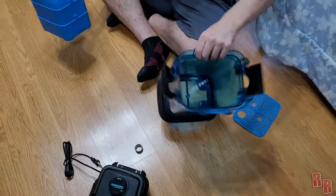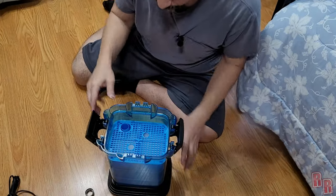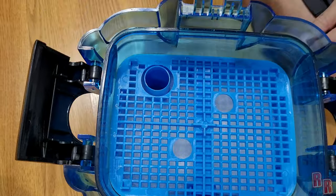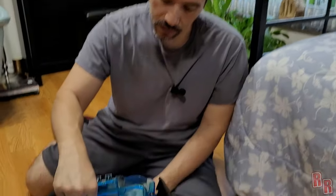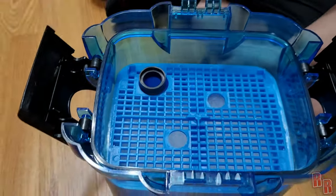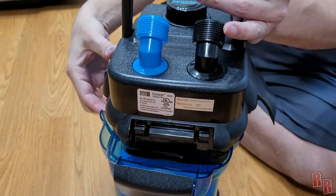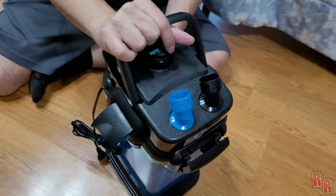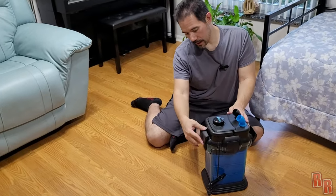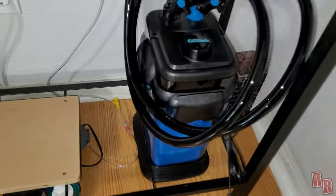Make sure everything is aligned in the center when seating the basket. The gasket opening goes over the center post. Get your finger in there and move it to center if needed. Once everything is lined up, place the lid, line up the hole with the post, drop it straight down, and it'll fall right into place. Clip all four side clips — over and down on each side — and the canister is back together. That's all you have to do to clean it.